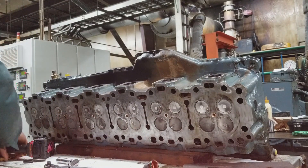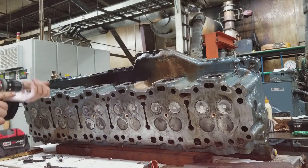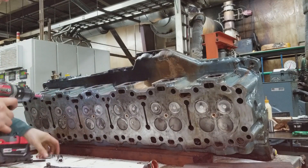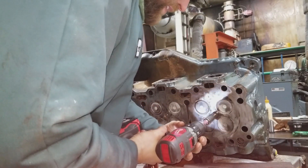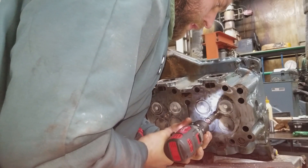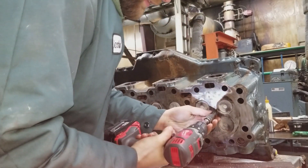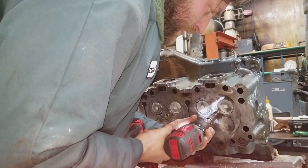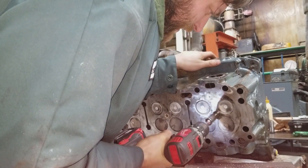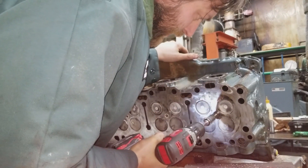Back around to the fire deck side. There's a cutting tool for the excess flared tip, and I do put that in my drill — I can't imagine trying to do that by hand; it would take quite a bit of effort. We're going to run that until it is flush. There is a specified depth: you're looking for flush to minus three thousandths, so that would be three thousandths below the fire deck surface.